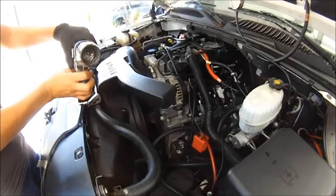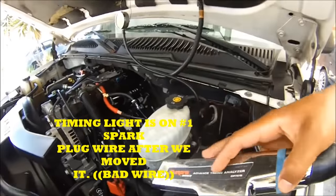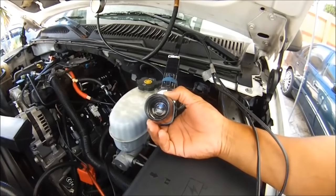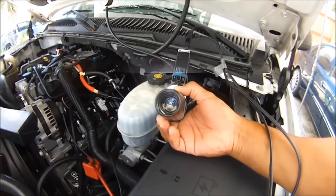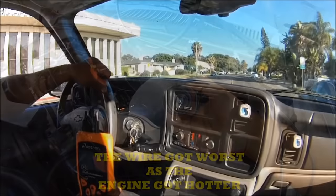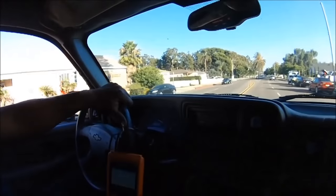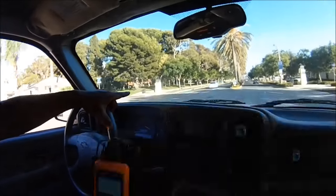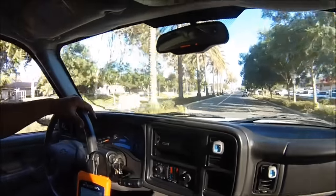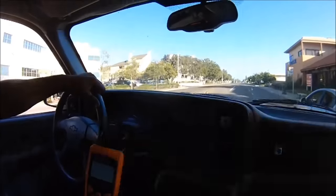Show us the light — see how it's off and on? Right there, that's got to be the problem. Look at the light, it stops — that's the problem right there. Earlier it didn't do that. We got a mechanic that put the wrong gap on these plugs. But we're still going to change these wires because that one's arcing, and we're just going to change them all because it's time — these plug wires are from 2004 and they're no good. The power's back, it feels good and strong.